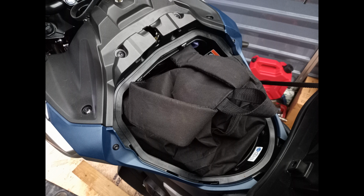But you can also gain access to the battery within that. So that's another thing that you might want to be aware of, if you want to fit aftermarket accessories to that battery. There is a cover there, and you have to push some little pins in to take that out, and that's where you gain access to the battery. So if you were to have battery chargers, Optimates and that type of thing, you would have to find a way of being able to connect that in.